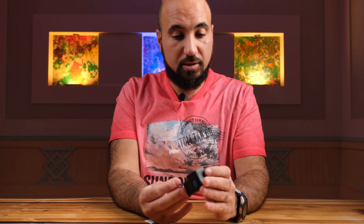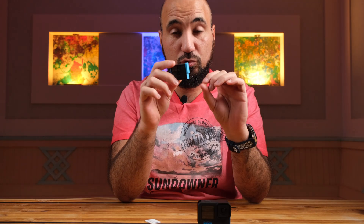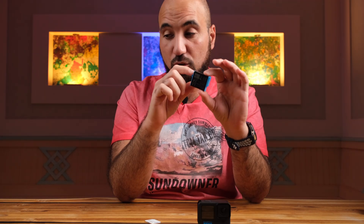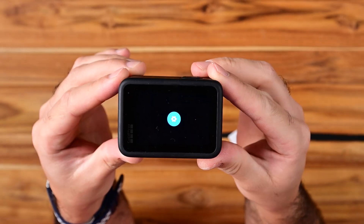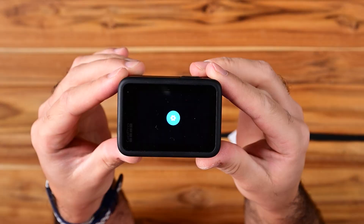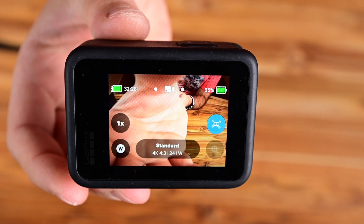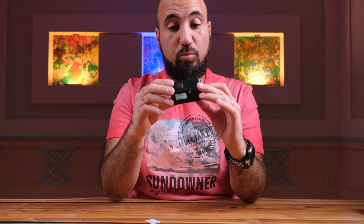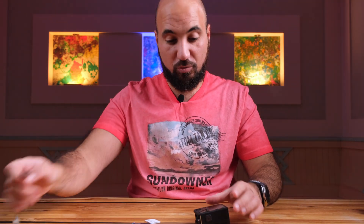Take out the SD card and put it in the GoPro. You have to use the original battery here, because the 'not enough power' message will pop up again if you use the LiPo battery. Put it back in and you'll see a screen indicating it's updating. The update completes and you can see GoPro Labs Beta is now installed. Turn off the GoPro, take the battery out, and try powering it from the LiPo battery.